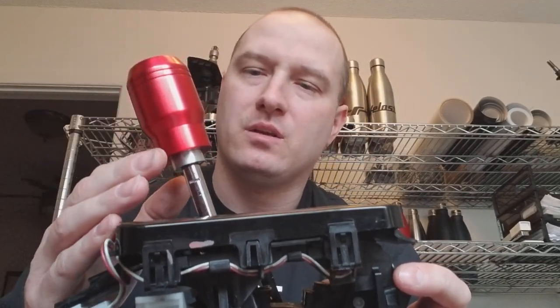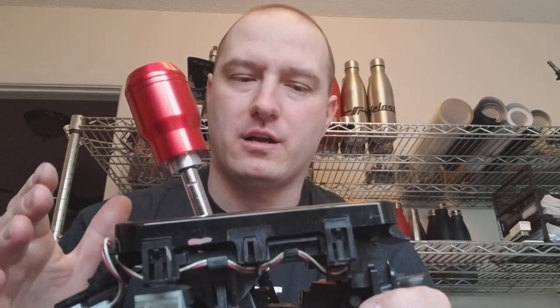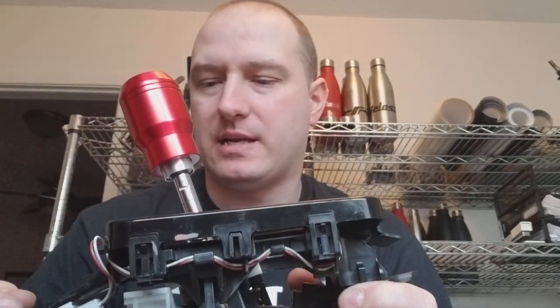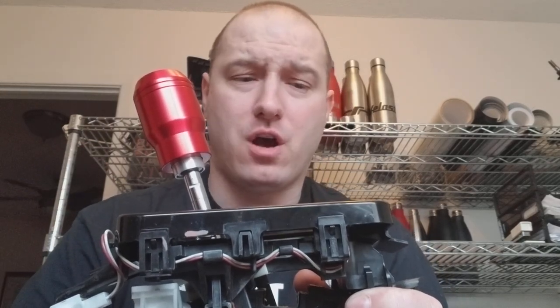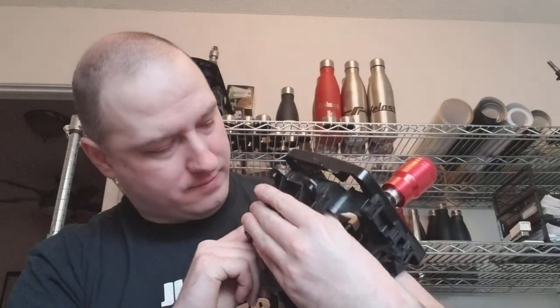When installing it, you have to follow the instructions very carefully. This doesn't change anything about the physical shifter — it's not going to change anything in your transmission or anything mechanically, because there's nothing electronic about this. All this does is sit in there, and when you press the button it disengages the safety mechanism built in here. When you press on the brake it sends or stops an electrical current, allowing the shifter to understand your foot is on the brake so it can shift — if your foot's not on the brake it won't let you shift. That's just a safety feature, and there's another little mechanism built into this thing as well.